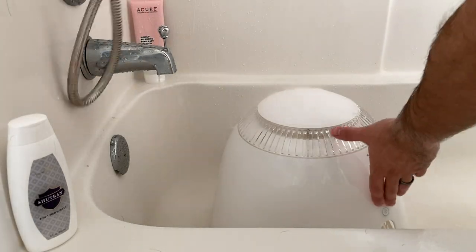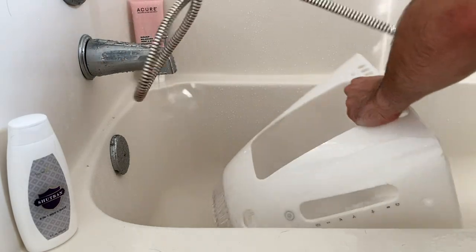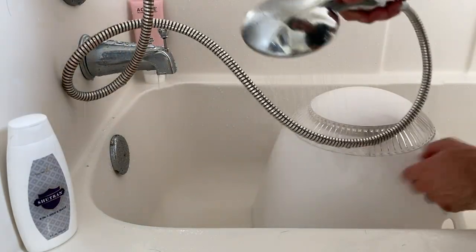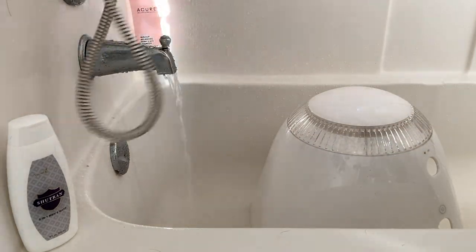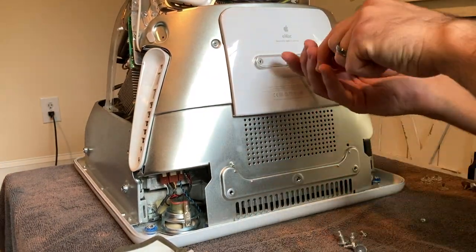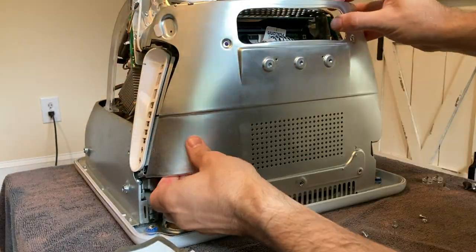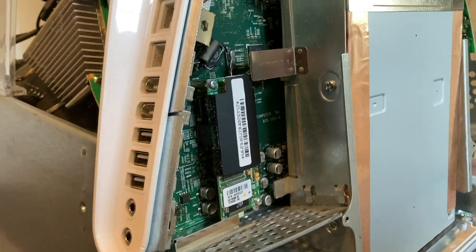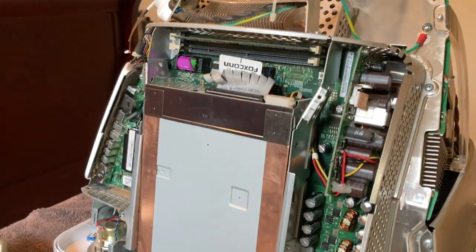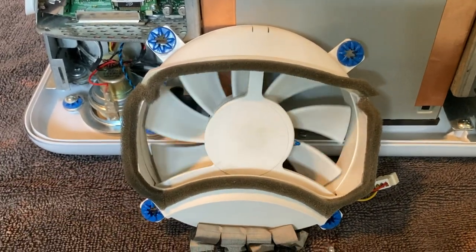For the back cover, I did not use a leaf blower this time, but I did utilize a bathtub, making sure to tape off the inside of the power button so it didn't get damaged. This proved to be a really good way to get the back of that vent and get all that caked dust out. I don't recommend doing this — do it at your own risk. We're also going to remove the back panel cover, which is where you would upgrade your RAM and replace your PRAM battery. I pulled away the metal EMI shield to reveal the back side of the logic board and cleaned that out as well. Be careful not to touch any exposed electronics as they could still hold a charge — this is a CRT after all. I was also able to get the fan fully cleaned.